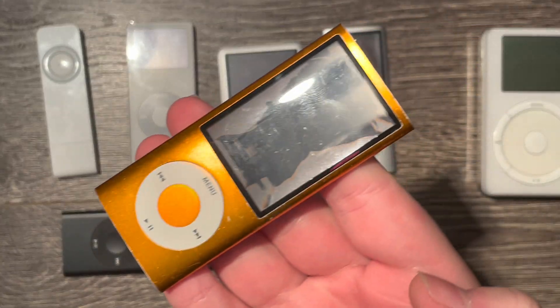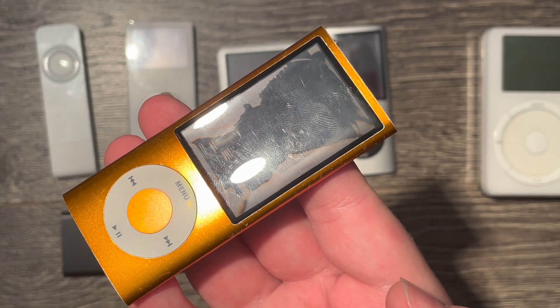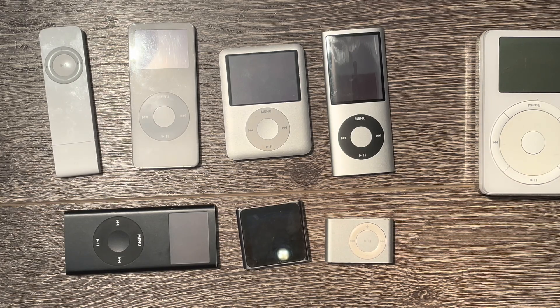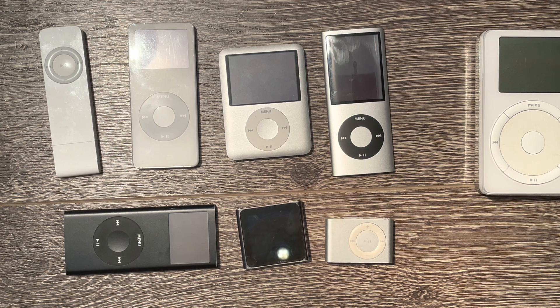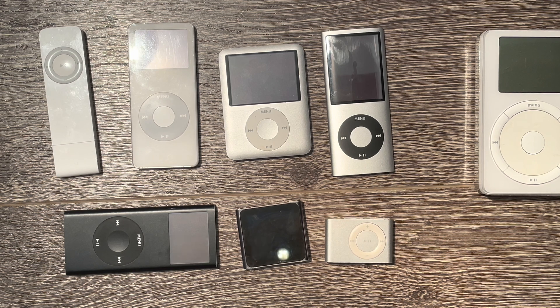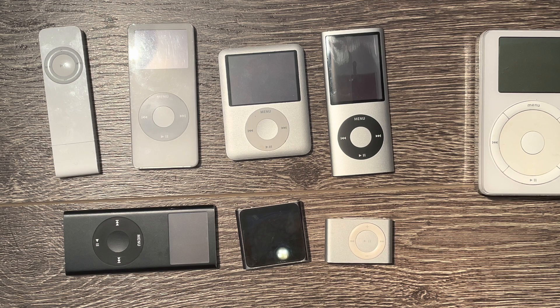Here I have an iPod nano 5th generation. As you can see, this one has actually expanded its battery to the point where it cracked the inner display and will soon be pushing the display out along with the glass. This iPod is no longer stable and in my opinion it's uneconomical to repair — I'd suggest recycling it properly and buying another one. Replacing the battery in this type of iPod is extremely difficult because everything is so compact that opening it and sliding components out risks piercing the battery, which could cause a small fire.